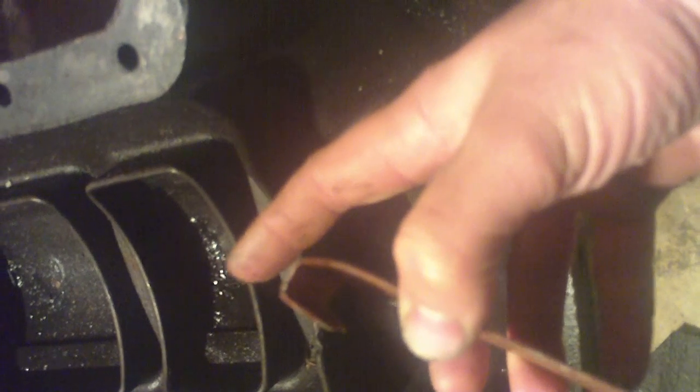After thinking about it for a while, I came up with an idea. I took a piece of 16-gauge sheet metal and bent a little hook on it to receive that flange up front, then drilled two holes in it. I stick it in here so it catches in the front, pull it back, and then I shoot two screws in these two holes with some Loctite on them. That locks this cover on and I'm hoping it'll keep the oil out — it's pretty much watertight and covers most of the hole and that whole sludge area. Seems like an easy enough fix that anybody could do, so if you have the same problem maybe this idea will work for you too.